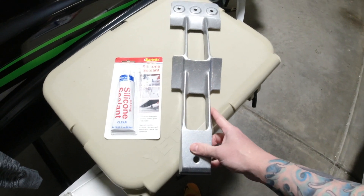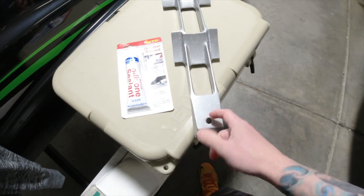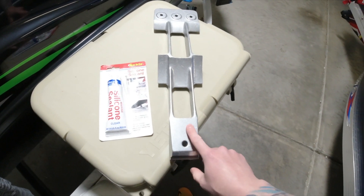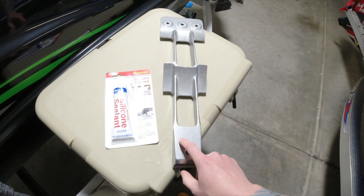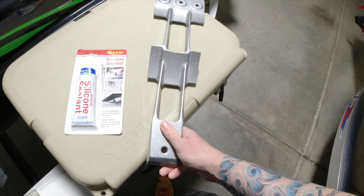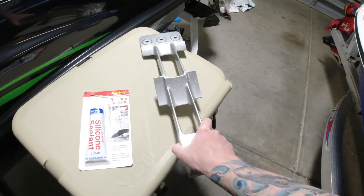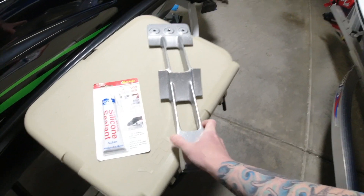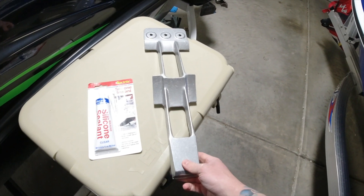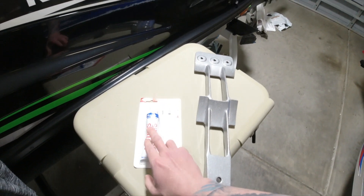I'm going to use blue Loctite with the stock bolts. They say to put silicone into where the bolts go, but I'd rather just use blue Loctite because I'd rather be able to get this back out. If you put the marine silicone sealant on, it's going to be really hard to take back off, which is a good thing or a bad thing. You don't want it to fall out — some newer Sea-Doos have been known to not have the bolts tightened enough, and the stock one will come out. I've removed the stock one before and re-installed it without issue.